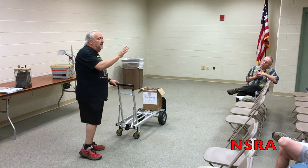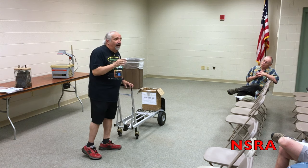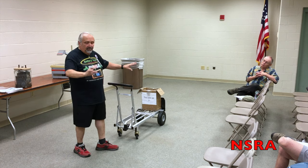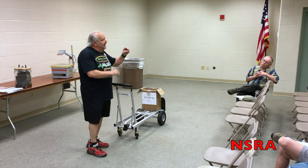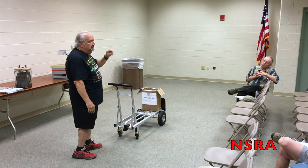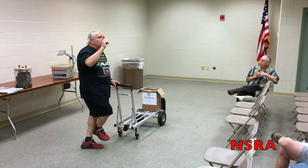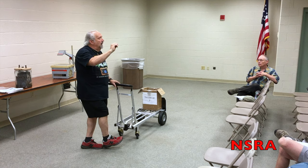So we turn these batteries apart and look for the amount of sulfation. One of the things I saw between a 7-year battery and a 3-year battery when I cut them apart is the distance between the bottom of the plates. On the 7-year battery it is about 1/2 inch. On the 3-year-old battery it is about 3/16. Well, why?